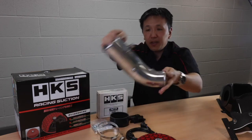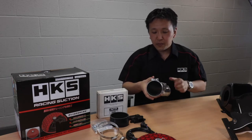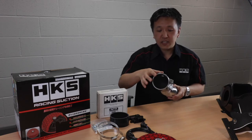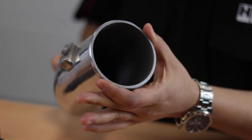The main feature of this pipe however is the fact that the diameter where the airflow meter is is different to that of the stock vehicle. What that means is the airflow meter signal is slightly disrupted, so it requires some adjustment when fitting to your vehicle.